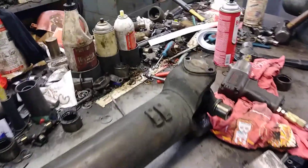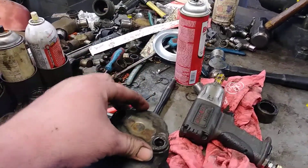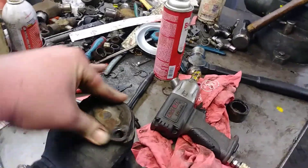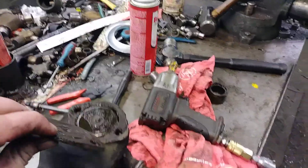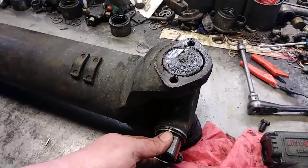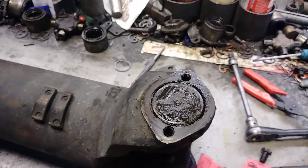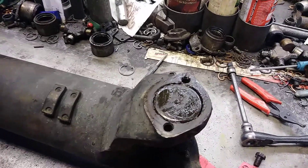So let's see if this one here is either broke or loose. I should not be able to turn this by hand — let's see. It's turning. If I grab this joint right here by the journal and start turning it, that cap starts turning with it. Look at that — see that cap moving right there?